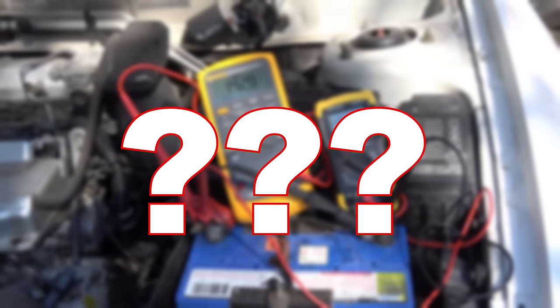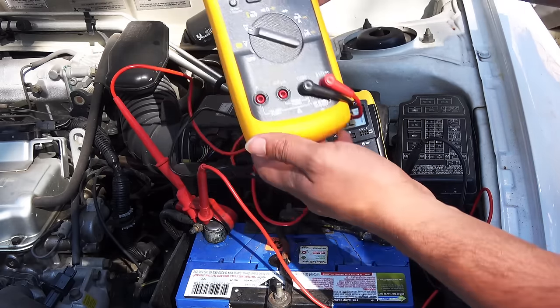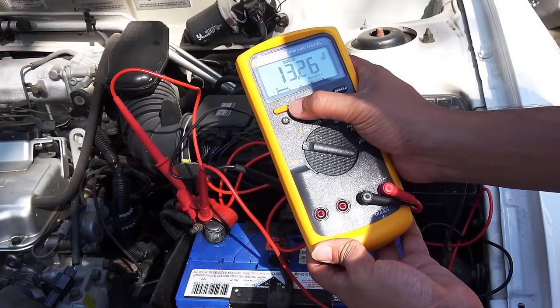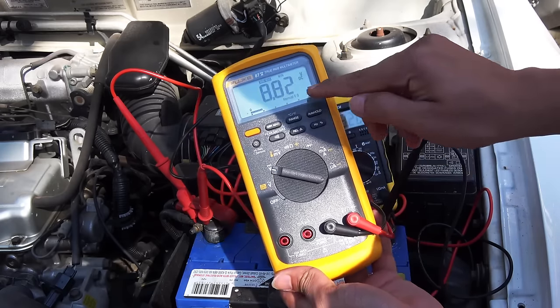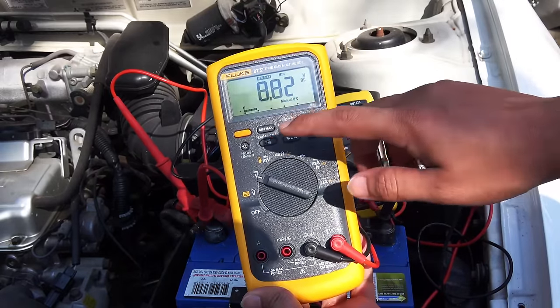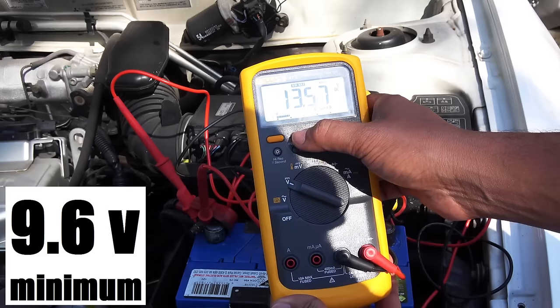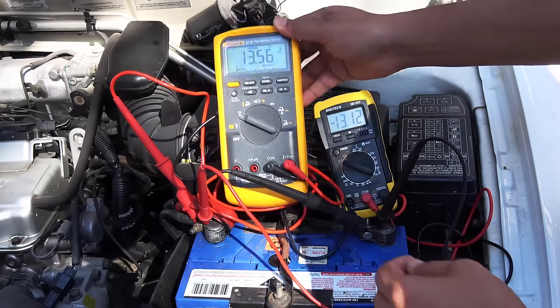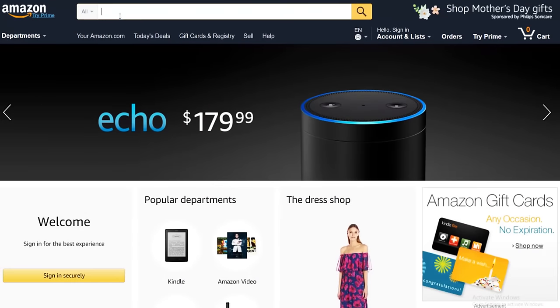Multimeters have a latency, meaning they take some time to process voltage into numbers. Inside the battery it only takes a few microseconds for the voltage to drop. This professional multimeter records voltage variances in microseconds. As you can see, the voltage on the battery actually dropped down to 8.8 volts, which is much lower than the 9.6 volt mark. So this battery is bad and will need replacement soon. That's how you test a battery using a multimeter — the downside is that a professional multimeter like this can be very expensive.